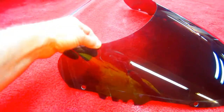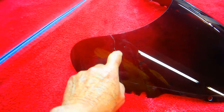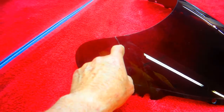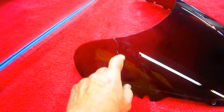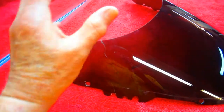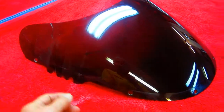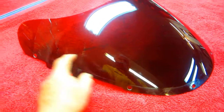Then this one broke. What happens — if this were an aircraft part where the crack starts in plexiglass, as soon as you see a crack start, you drill a little tiny hole, and most of the time that stops it. But because these are probably vibration issues, or at least this bike has taken a real beating, I've gone through three windshields. They've all cracked at different spots; I think this one's cracking down here right now.